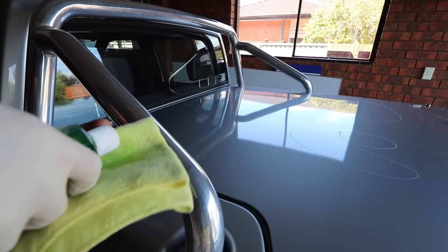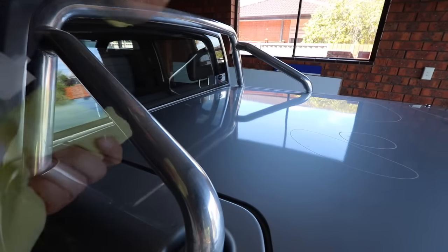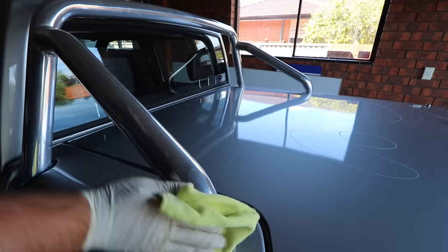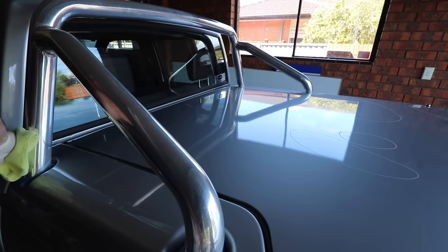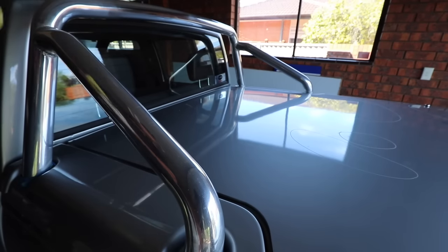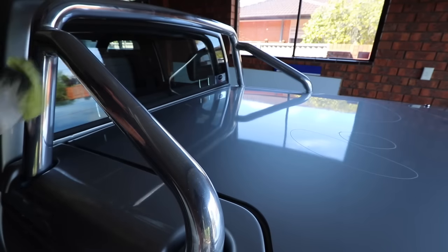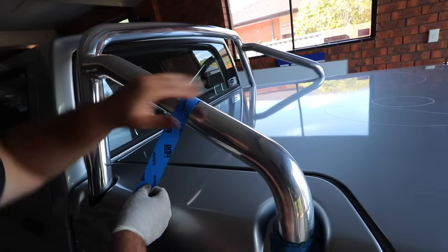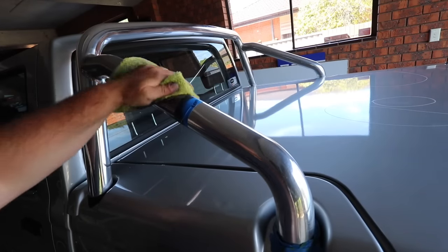I'll just quickly give you a look at the cargo roll bar metal polishing before we move on to the rear bumper. This was pretty much restored as per the front bumper. A coat of California Customs deoxidizer was worked on primarily. It was left to sit on the surface while the purple metal polish was worked over with some real elbow grease using a microfiber pad and then wiped off using a microfiber cloth.